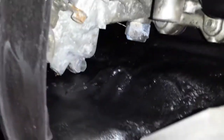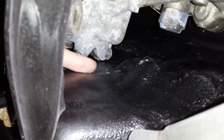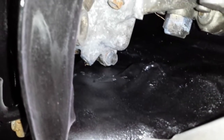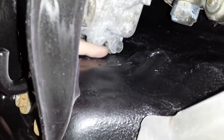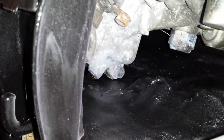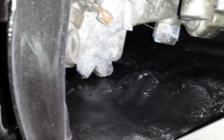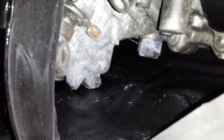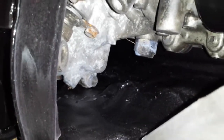This is how we did the clearancing for the R154. Just cut a little access panel out here, and then offset it and welded the top plate in. It's pretty tight, but I could have gone further here the way I did this too. But this way there was no big hammer dent on the tunnel, and all our interior panels actually fit properly. So this was a nicer way to do it, in my opinion.